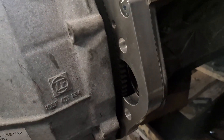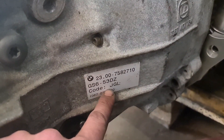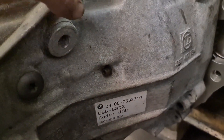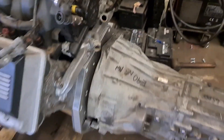This is the gearbox as it is now, and that's as far as it'll close. After some digging we've realized we've got the wrong box — the adapter plate isn't for this code, it's for a HGK, HKG, or HGU, same GS653DZ but the pilot where it fits onto the flywheel must be shorter on this box. Problem is it's already been modified to take the starter and the crank sensor. So we'll probably leave it there for now with this episode and see what we're going to do next and come back to it on the next one.